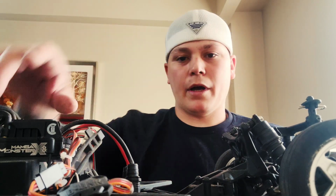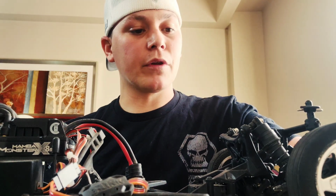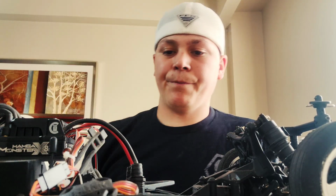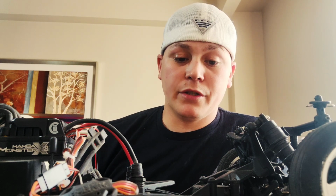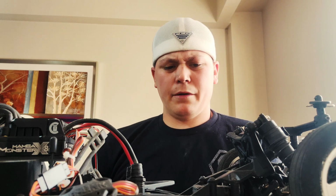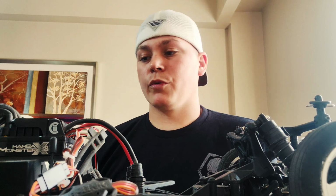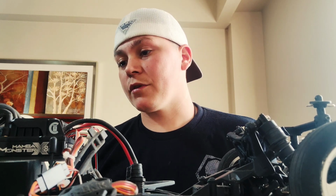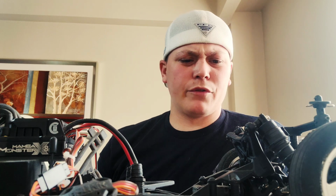Now I am running obviously the stock Mickey Thompson Losi 22s front wheels. If you guys haven't been able to notice, I am running the Losi 22s drag car chassis. I am running a Savox 1268 SG Black Edition servo. Pretty well. I'm running the 6400 kV Castle motor as well. Quite honestly, most of the stuff that I'm running on this is stock. I'm running a stock spur gear, which I need to change out, it looks like, because it seems to be egg-shaped. I'm running a 25 tooth pinion.